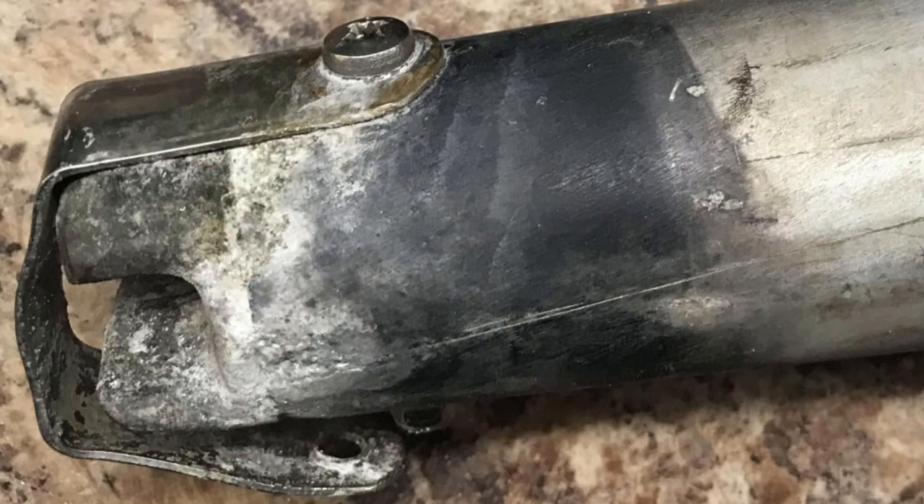I've just recently seen on EverythingAboutBoats.co.uk their boat and rig checked, and they found that the spreaders had split. Part of the reason could be the rig was over-tensioned, and there was oxidization on the end. You get these little boots - plastic or leather - to protect the sail from the ends of the shrouds. Water gets in there and can't get out, so you've got salt or brackish water held against an anodized aluminium fitting. It oxidizes, the protection is gone, the aluminium weakens and can split.